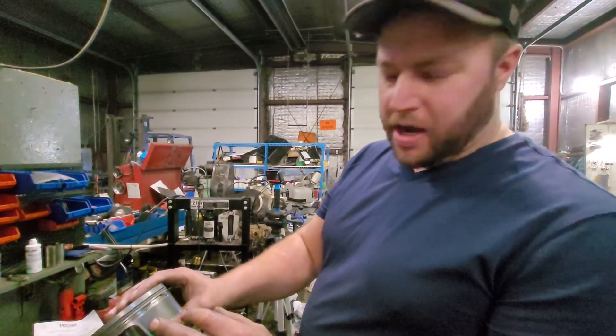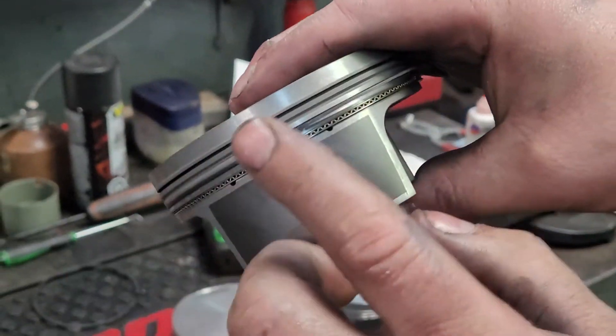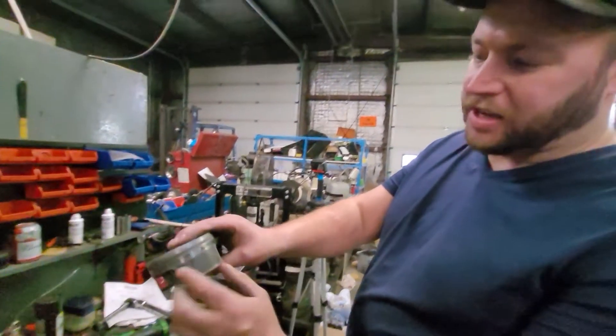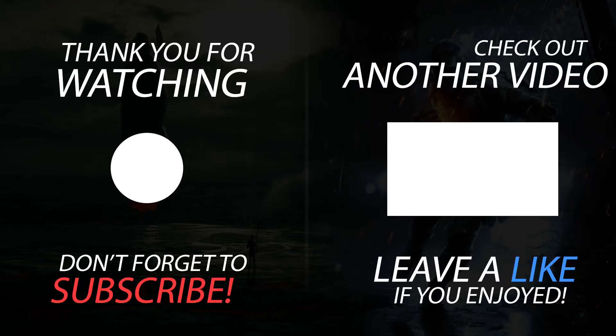Hey, so I was putting this ring on. We were talking earlier about deburring the edge of the piston ring - this one I must have missed. As I'm going back together, putting a very gentle pressure on there, it's not sliding in freely. That means that one probably got missed or didn't take all the burr off, so it's got to come back off. That's how you'd be able to tell you're having a problem with a burr on the edge of a piston ring. Thanks for making it to the end of the video. Part three will probably drop sooner than part two did - thanks for the tremendous support during part one. This was about ring gapping and ring installation. Like, subscribe, and I'll see you on the next one.